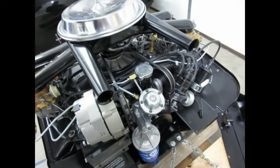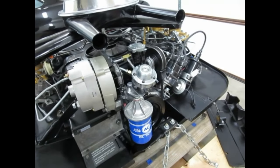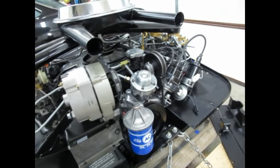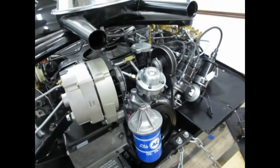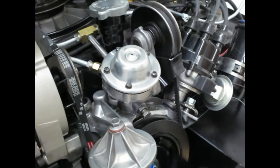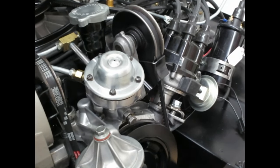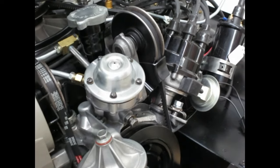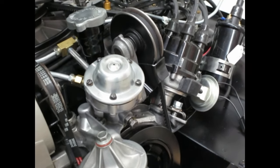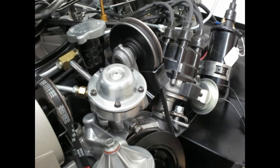and ready to go. Now, I have changed the fuel system on this, where it's set up for electric fuel pump. I don't have any confidence in mechanical pumps anymore. I've had too many failures. The last brand new fuel pump I used, it's a Delphi. And after running about a minute or so, gas starts squirting out of the vent hole on top.